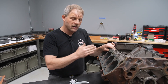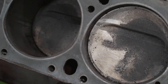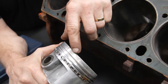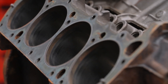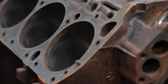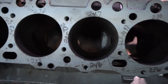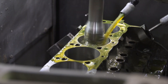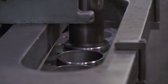You can find pistons or have custom pistons made everywhere in between, but the caveat is you also have to have a ring that coincides with that same bore — so the limitation is really more the rings than the piston size. Knowing that this block is already 30 thousandths over, we're limited to 40 and 60 thousandths for the most part. That's going to be a very good conversation to have with your machinist, because he'll look at the bore in more detail and with more experience and say whether it will clean up at 40 with a hone, or whether we need to cut the cylinder to 60 thousandths and then hone.